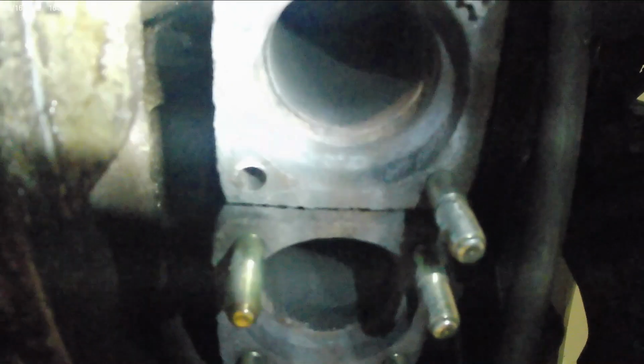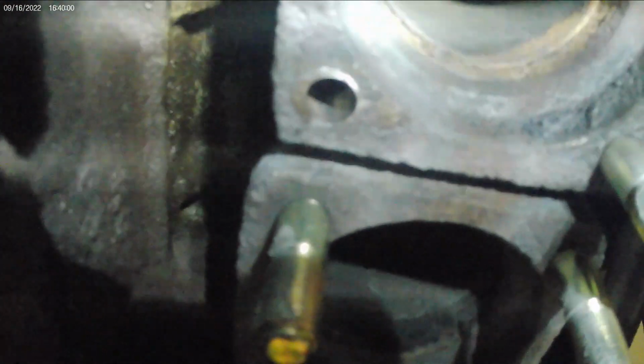The right side, putting up a little bit of a fight. I got new studs in there, look nice, not a problem. I was able to drill the broken studs out of there. But when I started to tap this one, look what happened. Broken tap. Not cool at all whatsoever.